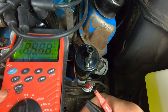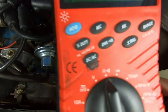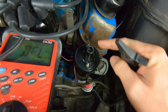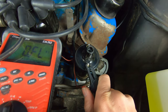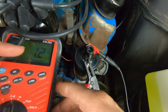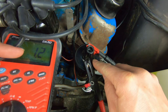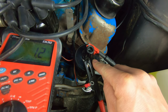First thing to do: I've got my digital volt-ohm meter set to ohms. If you're new to testing resistance, I like to zero out my test leads — clamp them together and you should see zero resistance. Then you're going to test from one point of the coil to the other, negative to positive. It doesn't matter which leads go where because you're simply testing from one point to another. We are reading 1.2 ohms on this coil, which means we are under the minimum of 1.5 for the primary resistance circuit. So we are going to want to run the original resistance wire on this car.